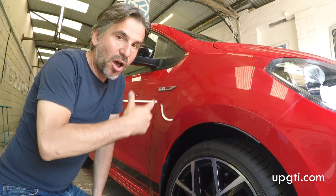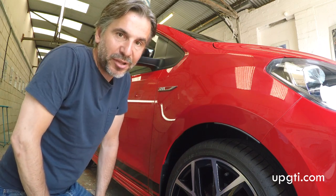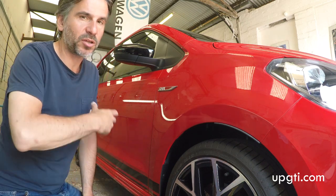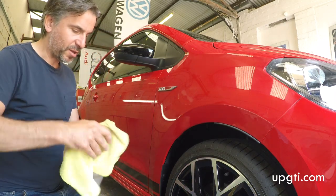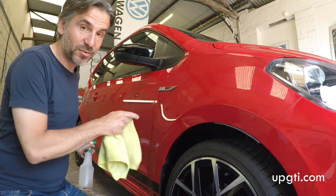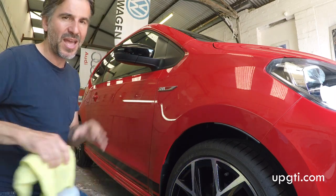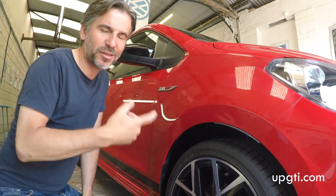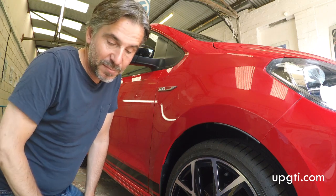As you can see, the car's indoors now. It's a little bit cooler in here because the sun's come out and the last thing you want to do is do this polishing process in direct sunlight — it creates friction, which creates heat, and heat creates holograms. So the cooler it is when you do this work, the better. I've already done the tar and glue — this is a product called TARDIS. I put it in this bottle, spray it on the car, leave it to melt the tar which starts dripping down the panel, and then you just wipe it off with a microfibre. There were some bits on this car that looked like body corrosion wax on the paint, and that just wipes off in no time at all with TARDIS. Now we're ready to do the polishing.